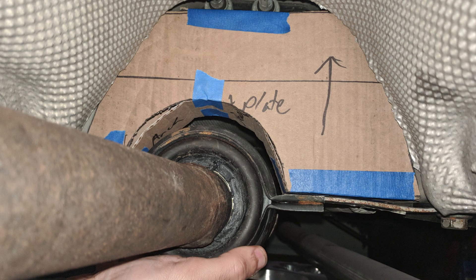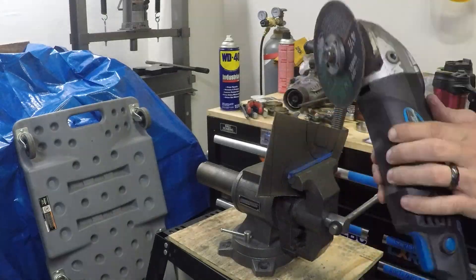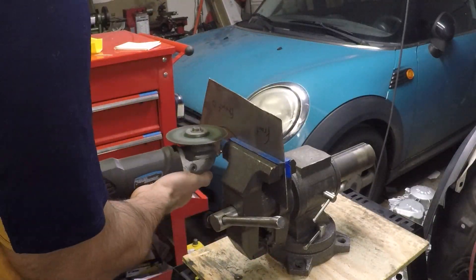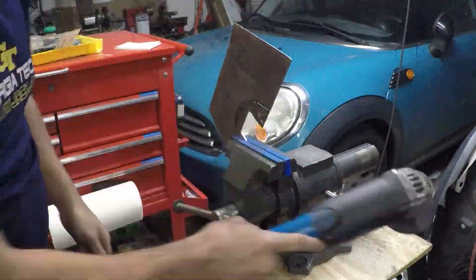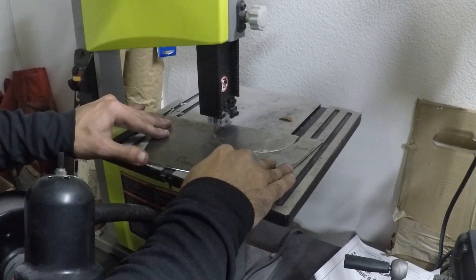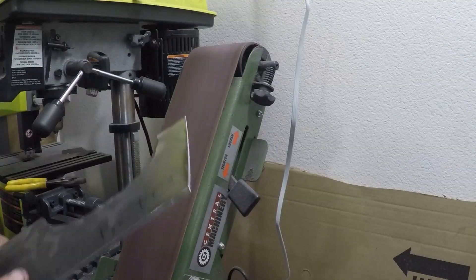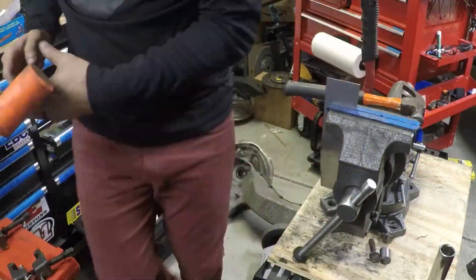This is what it looks like in the car — we've got the driveshaft carrier bearing holding in place, and that's where we're going to weld it. We cut the heat shield and then go into cutting the actual sheet metal. We used a combination: 1/8 inch in some areas, but mostly 1/16 inch or 16-gauge steel. We found this was pretty good thickness, especially when you box it up and keep it in very short sections. If you're going to have a longer section, you might want to go with 1/8 inch plate. The challenge with 1/8 inch plate is that the sheet metal in your car is not 1/8 inch thick, so you're welding to 16-gauge or 18-gauge metal — it ends up being very difficult, and you might need to reinforce the chassis.